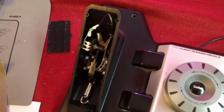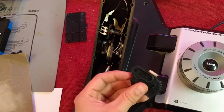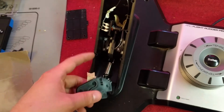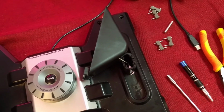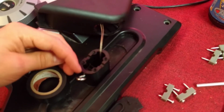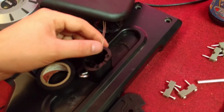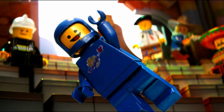What I'm going to have to be super careful about is making sure that the teeth are at the same position. So once I reassemble, I'm going to make sure that this tooth is just outside of that one at the resting position. And now I'm going to go to the reassembly and show you what it looked like with all the parts together. One more thing before I reassemble, I used a little bit of electrical tape on the inside, because I do not know if the Hall effect sensor cables will actually make a problem with that. So just to avoid any risk, I layered everything and insulated everything so it doesn't touch the metal.